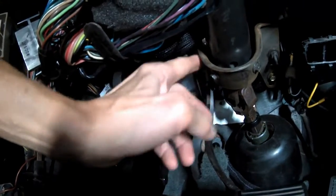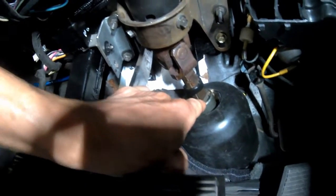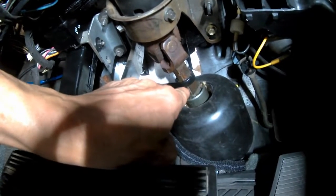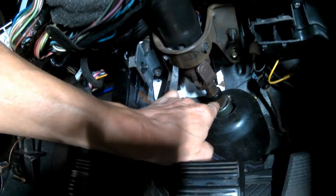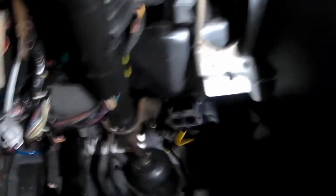To get the steering column out, you've got a D-opening in the rack and pinion — this slides right out. It's got a spring-loaded clip here, so once you drop the column down from the dash, you just pull on this and this metal inside piece slides out of the female piece. And of course you've got all your wiring you've got to disconnect. When I get the column out, I'll show you what that looks like, but it's real easy to pull a column out.